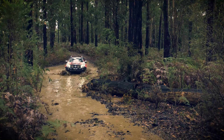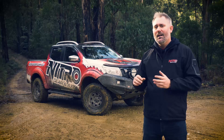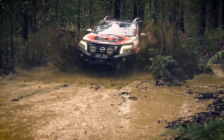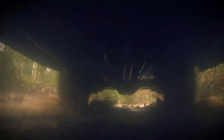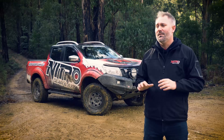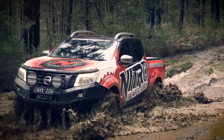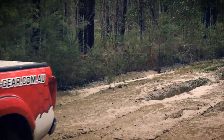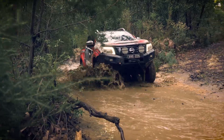For most people you jump up a couple of points — so from a 4.1 to a 4.3 — and that'll help when you've gone up an inch or two in tyre size to get back power and economy. Your low range will be better as well for when you're crawling off-road. That means you'll have more grip without revving the car so hard; it'll be able to crawl after your lift kit and your tyres. Re-gearing is probably the next thing you really should do if you're serious about off-roading.